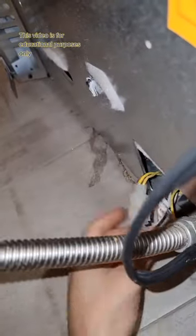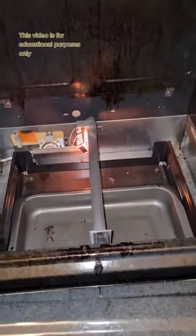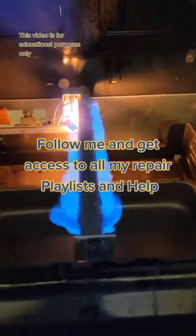All you have to do is plug it back in, and I like to test it before I shove everything back together. This thing should glow cherry hot. A few seconds later the gas valve is going to send gas to the burners, and you want a clean blue flame.